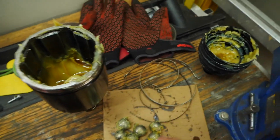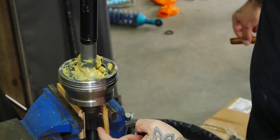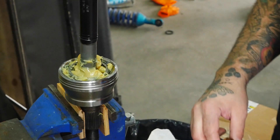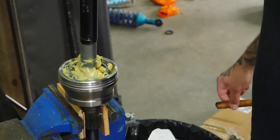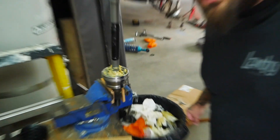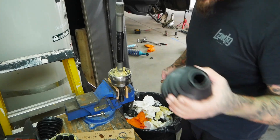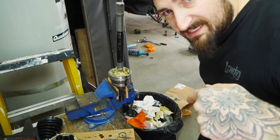We're back to where we were. This is the color grease I was talking about — it winds up in your fender liner and wheel well and looks a lot worse than the darker colored factory stuff. I've got the axle in the vise between two pieces of wood so I don't mess up the splines. I took some of the big grease glob out, I'll squeeze a little more in but leave the majority of the factory grease. I'm going to clean this ring off, wipe it down with brake cleaner to get all the grease off as much as possible, then put the boot on and clamp it — then we'll reassemble the other side.